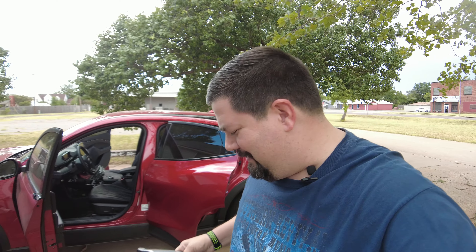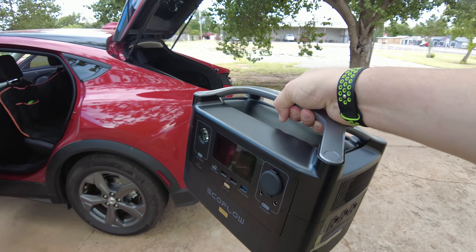When you plug in a charger into the Tesla on AC, you can pretty much control any amp you want — you can set it to pull five amps if you want. Here in the Ford, I don't have an option on what it pulls, and just plugging it in is going to pull probably more than 1,200 watts and will probably max this thing out and it will overheat or overload. But let's just see what happens just for fun. Why not?